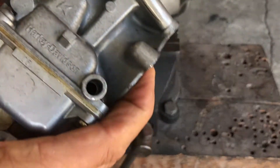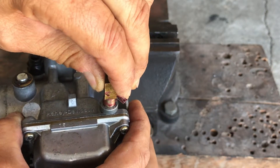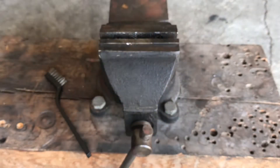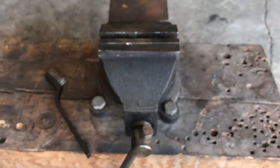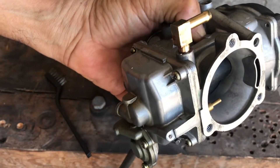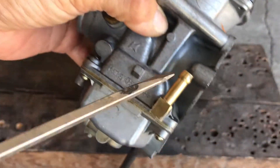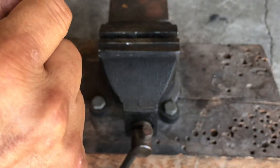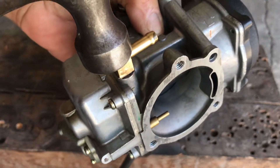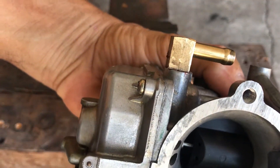Here's my carburetor. You'll see this is a machine fit, so it's slightly tapered. Now you know how your bike is and how this came off — this isn't complicated now that we have it that far. I'm holding this — slight taps. Make sure you have it at the right angle. You can take a 10 millimeter and turn it. That's pretty much where it needs to go. Now drive it all the way. You see? Now that's installed.